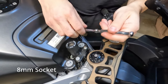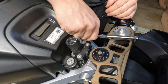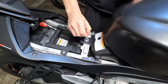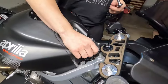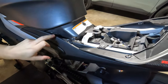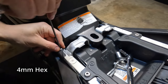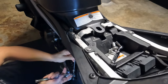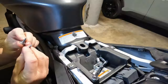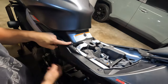Next I'm going to remove this side fairing so we can have better access to the tank. We need to get in there to press this and have better clearance. Under the tank we need to remove three hoses — I believe there's a four millimeter bolt for this one here, and one underneath over here. So one, two, three underneath basically.